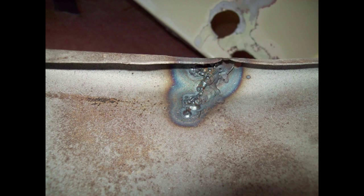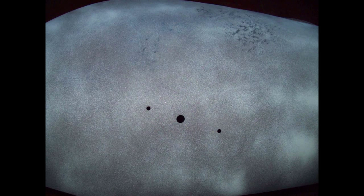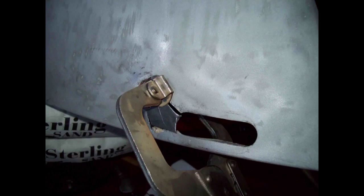All splits need to be widened to an eighth inch or so. Here I've had to reinforce the edge of a fender. These splits need to be cleaned up on the back side as well for a show car. Here's another place to be repaired on the bottom edge of a fender. My left rear fender had way too much body filler in it, and I had to remove that body filler and work those dents out better with a hammer and a dolly. Clamping a piece in for welding — magnets made for this purpose work well too where you can't get a clamp in.